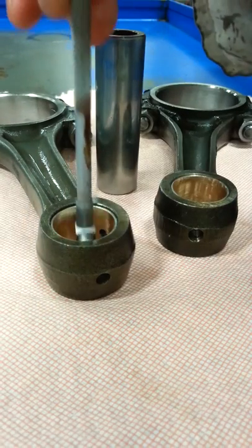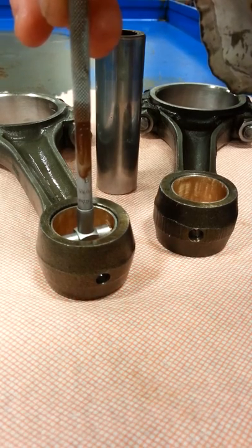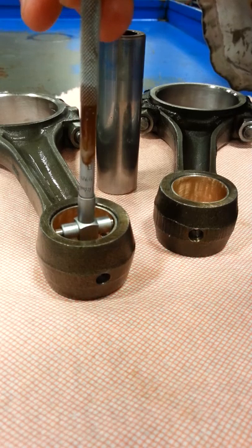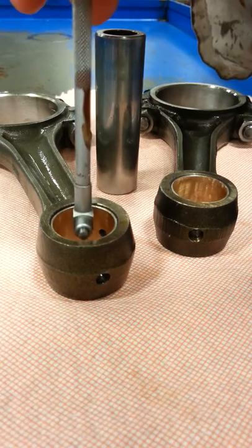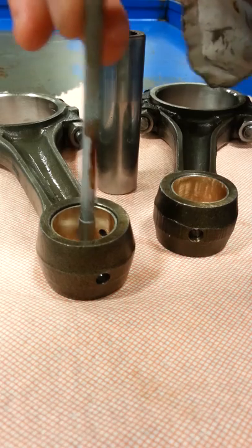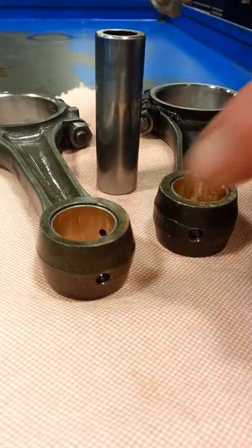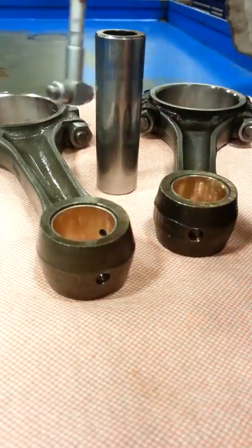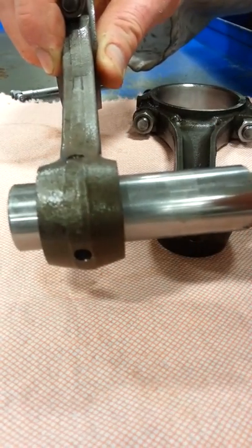I'll just go ahead and re-measure this again just for the sport of it and see if we have any variation. Another way you can check it is if you snap the measurement in one dimension and rotate it across a second axis and it's tighter or looser, you know that you have a variation in the dimension. I'm also checking the pin-honed fit that I did on the last video to make sure that my clearance is the same dimensionally top to bottom in this particular bushing. It feels really good. If we had a tight spot, it would indicate that I honed off-center or created a taper effect on the connecting rod - and what we don't want is that tapered effect. We want a nice even fit so that the pin slides through.